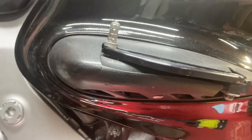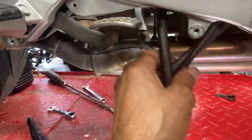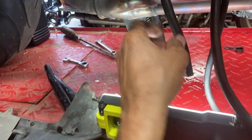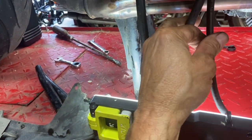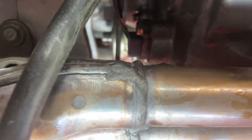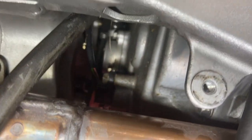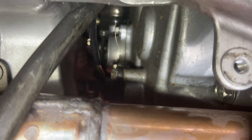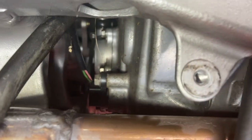Now I'm on the right side of the machine, down below the swing arm. Here's those hoses again. I've pulled them out even farther now, got them all the way out of there. Usually one's a vent hose, one's usually an overflow hose for the carburetors, and one's usually a battery hose, but I don't think they use battery hoses anymore. And you actually get a better view over here. Right up in there, there's the slave cylinder right there. And it looks like there's two 8mm bolts on this side and one on the other side.